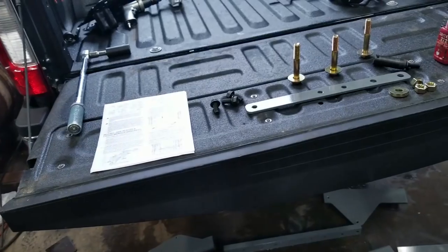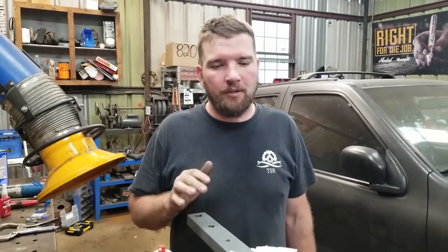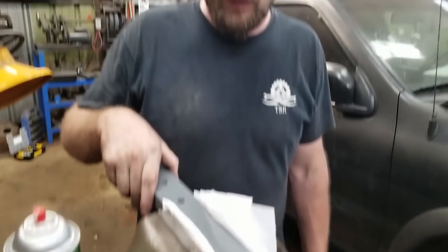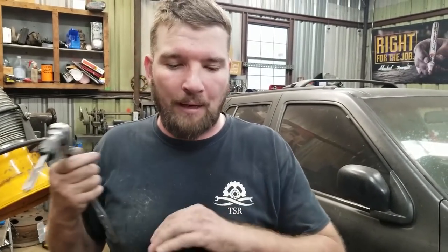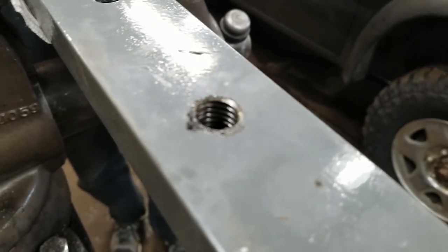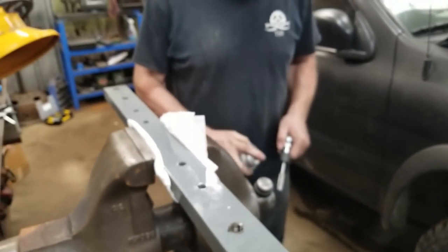So these are the outer plates. The 4-wheel drives and some 2-wheel drives come with a plate mounted right there — that comes factory, welded to the frame. Factory welded to the frame. Chucky didn't weld it — we don't trust Chucky's welds. We've got to put these brackets in there — the brackets go in there, then the center section goes in there, and then they'll be ready. The outside bracket's threaded and bolts on here; the inside where the fifth-wheel deal goes bolts in there too. They powder-coated everything, so I couldn't get the bolt started, and we pulled it back out and ran a tap through it to clean the threads.